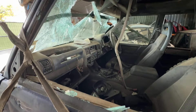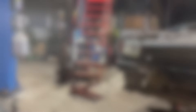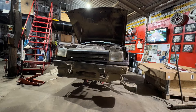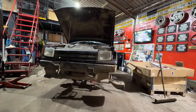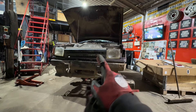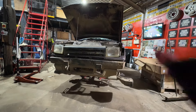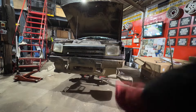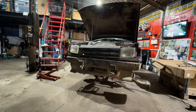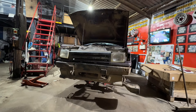I have a battery on charge and I've put the front on axle stands for now so I can get underneath and undo the prop shafts, maybe the exhaust and the gearbox mounts, and the engine mounts. Then I need to strip all the front out — take the grill out, headlights, whatever, cut the slam panel out. And then we can start thinking about getting the whole lot out. I also need to drop the gear selectors and the handbrake. But first thing — I'll strip the prop shafts off and the front end off. Before I start removing it, I want to use that battery and see if we can get it to fire, and then we can advertise it as a good running engine. So let's get on.